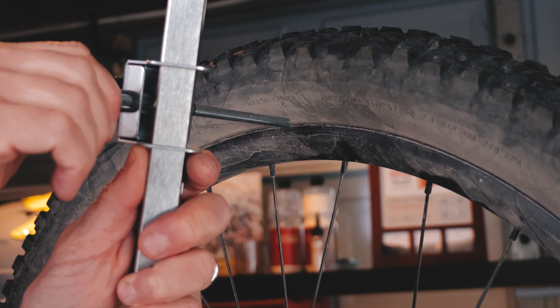What we're going to do is measure the amount the hanger has bent and then gently bend it back. Swing the gauge down to the bottom of the rim without moving the pin and compare the gap between the pin and the rim. You can see we're about a half inch off the rim at the bottom, and that means the hanger is bent quite a bit.